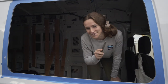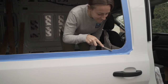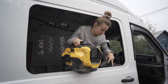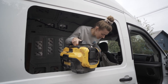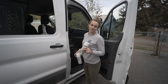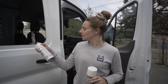Because rust is the enemy, we need to make sure everything is nicely filed on the edges before we protect it with paint and primer. I finished filing down the rough edges, so now I'm going in with the vacuum cleaner to get as much as I can in the groove between the two pieces of sheet metal and around the perimeter. Vacuuming is all done, so we're going in with the automotive primer and then follow it up with two coats of Rust-Oleum to protect the exposed metal.